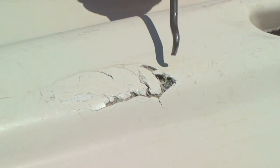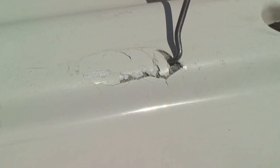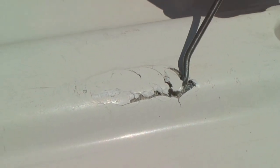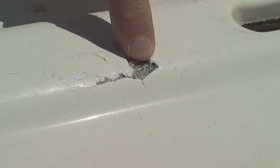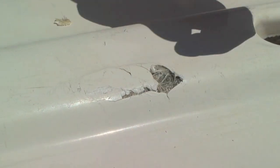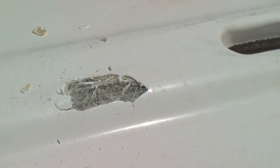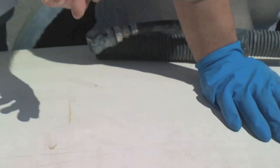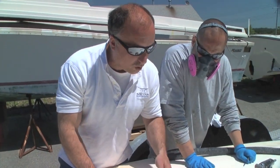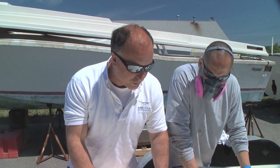Also a good clear sign: if you look and you see the top laminate is actually all dry, that means it was just a resin-starved area. And watch this — you can see it as we peel it away. See how the fiberglass strands have no resin in them whatsoever? This is a common problem. Just because it's a Sunfish or any other boat, this is something we run into all the time, especially with all the warranty work that we do for different manufacturers.